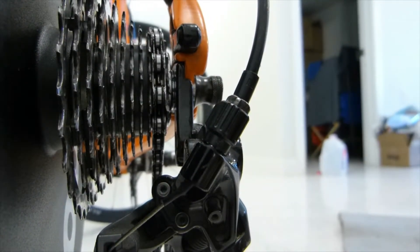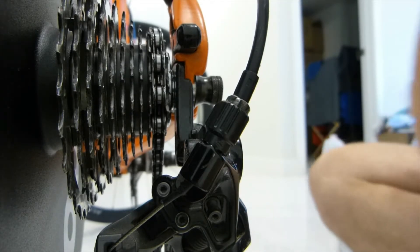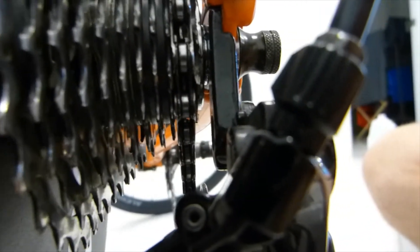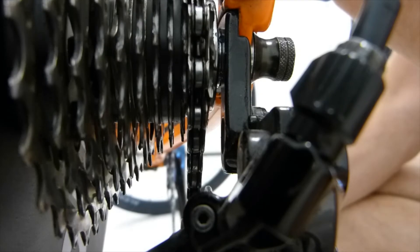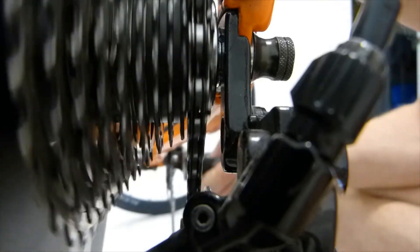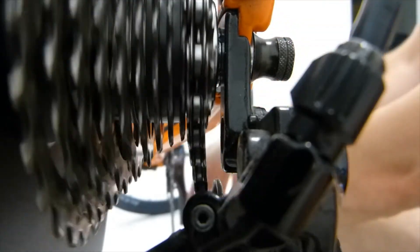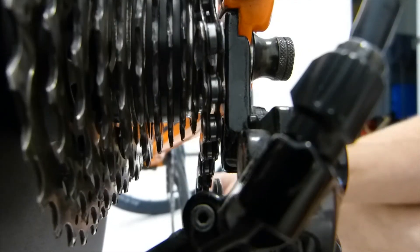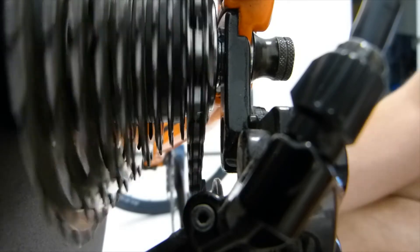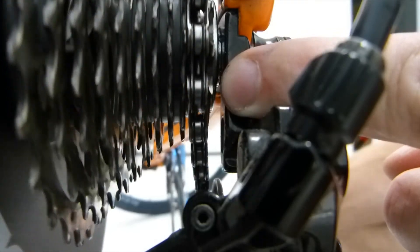When the bicycle just doesn't want to shift and it makes the extra noise — so far so good, it's as quiet as it can be. And if I shift down, that's where the source of the noise is coming from. If I go slowly enough, you can kind of see that the chain wants to jump on the smaller sprocket, and it almost did it there. That's where the tips of the teeth on the smaller sprocket are hitting the side plate on the chain.